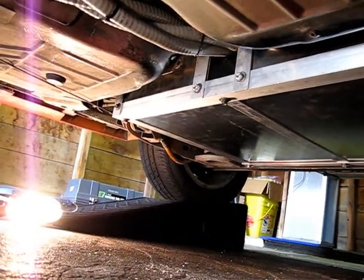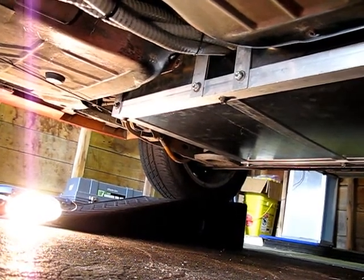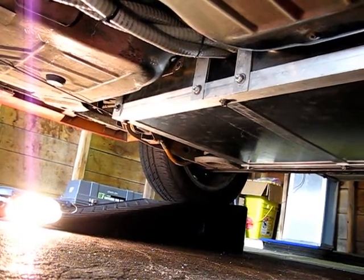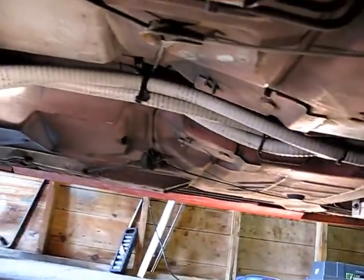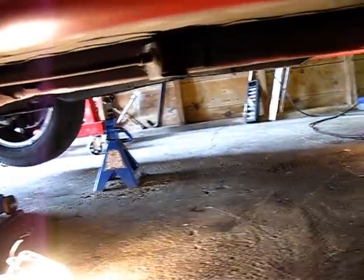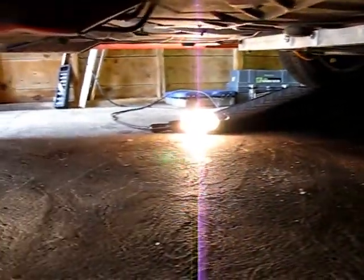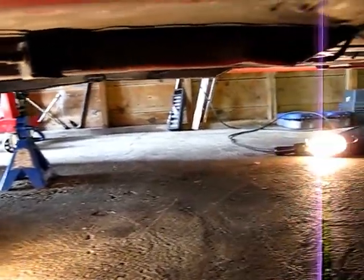But then the 3rd cable is just the DC positive and negative that go from the charger up to the main distribution point. You know, the high voltage wiring shelf up front. So anyway, there's the wires. They're all carefully zip tied up in there, so they're not gonna be dragging. Again, from a profile shot, there's nothing hanging down under the car. Lowest point being the mid battery box and these support beam type of things.